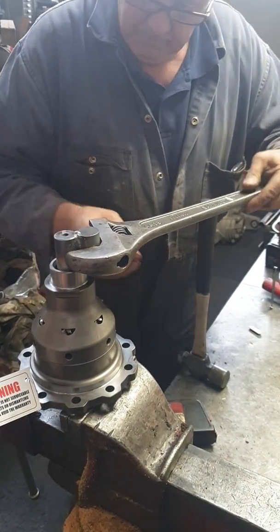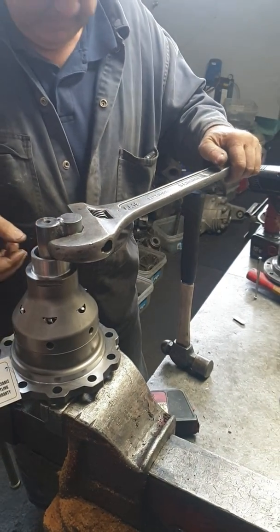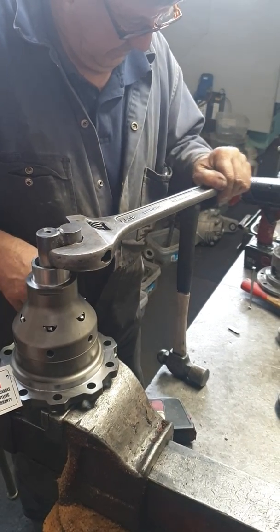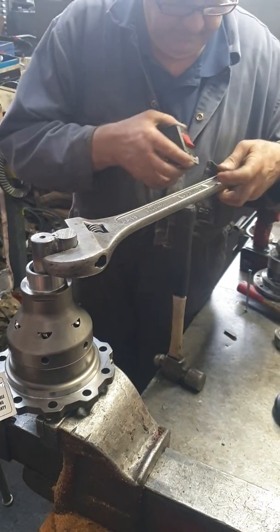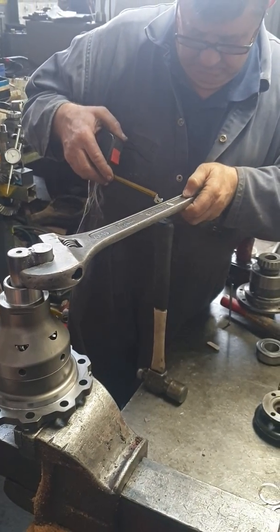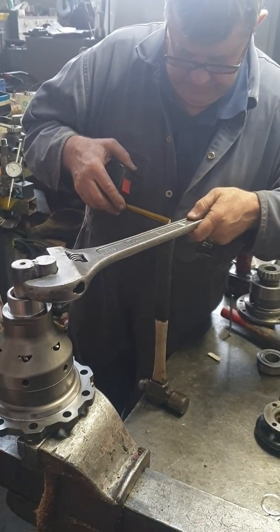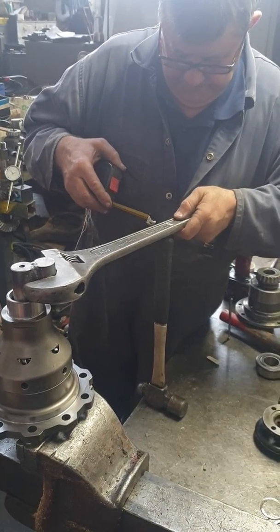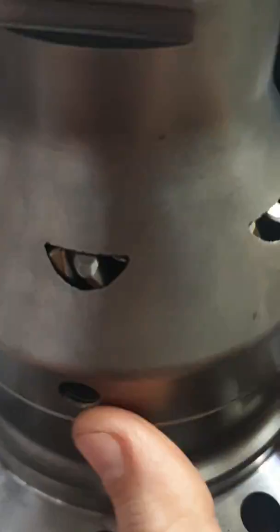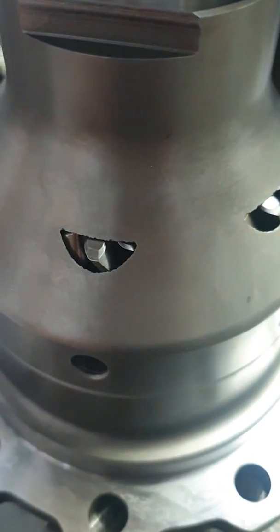This is the backlash in the helical LSDs. Put an axle in there — see how much backlash they have, and this is brand new. That's the movement in the bores of the helical gears. That movement — that's how much it'll go from reverse to drive. One inch of movement represents the radius of the wheel, the outside of the wheel.